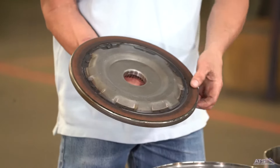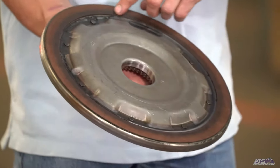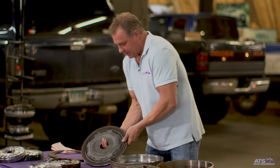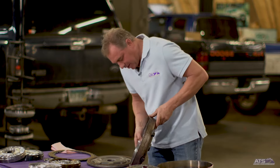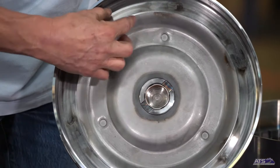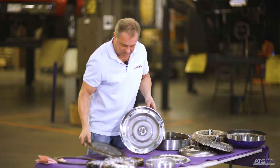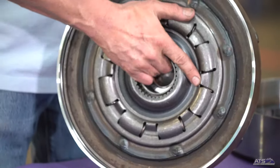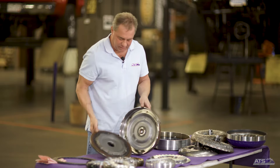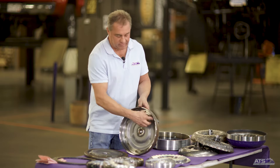As you can see, this is a clutch disc that's been in the vehicle for a while — it's obviously failed. You can see how burned up it is. That black is burned and glazed friction material that was slipping on the cover. You can tell it was slipping pretty substantially because of the black marks — it was hot enough to actually blow the material. As it begins to slip, it literally burns up the friction material. As it burns, the torque converter clutch slips, you can't transfer power, and all that friction material peels off the piston and contaminates the transmission and clogs the cooler.